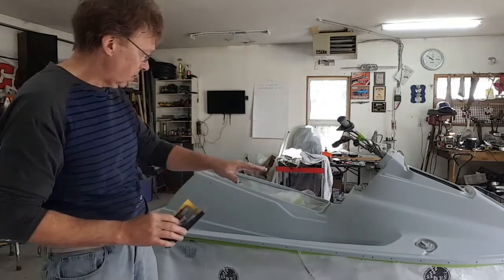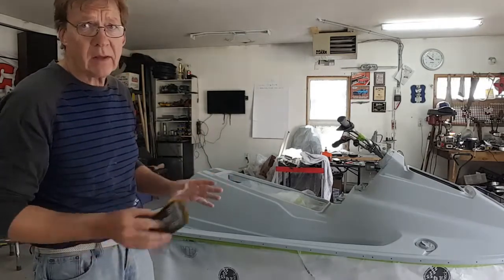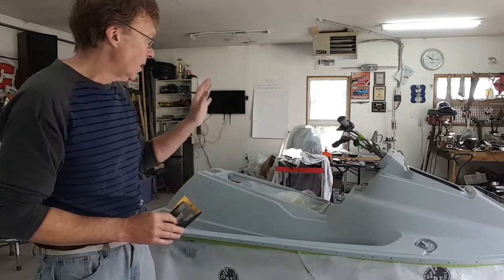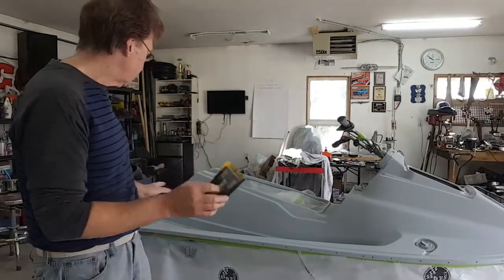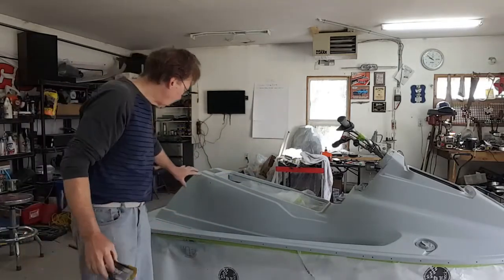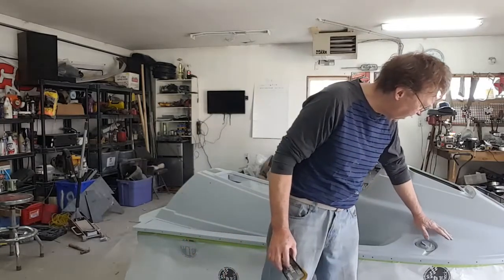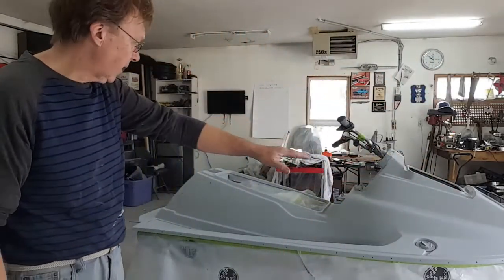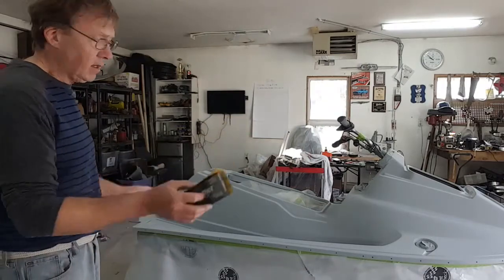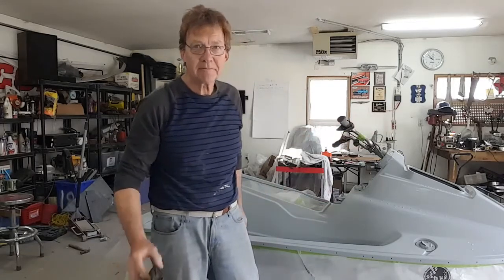This is literally just to flatten all the flat surfaces — take out any bumps I can, bring it down to about 400. I'm not going to use a guide coat. This is just to get the paint onto the vehicle, so I'm going to wet sand it with lots of water and sandpaper. We now know we're going to be painting this area white. I've decided to put the letters up in this area — it's bigger. I bought three-inch ID numbers, but when I put them lower they kind of rolled, and I didn't like that look. So this is the area that's going to be white — white there, and a white stripe on the side. I'm just going to cut this paint down and then throw some white.